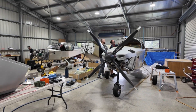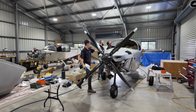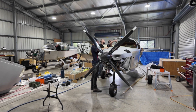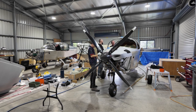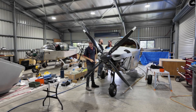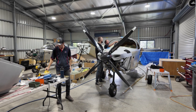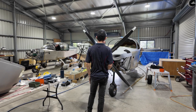You can possibly start with all that silicone — that needs to be dug out. Be careful not to scratch the window. Take the little blade, put it in there, then put the blade sideways and it just comes out. There's quite a neat little gap between the window and the frame, which is nice. On mine there was almost no gap — it's hard to put new silicone in there. I think that new V-seal that we have is going to work very well on here — much better than the other one, and it also sticks to paint really well.